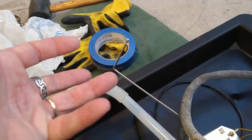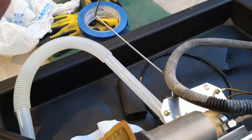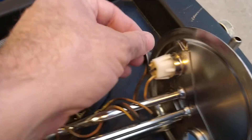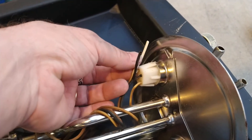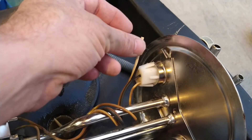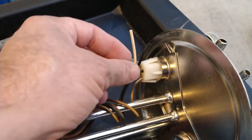That happened within four or five years. Now I'm getting ready to put the new pump in and I'm looking at the old pump to make sure it's the same. I look at the insulation over this wire — it wasn't an inch and a half too long when I put it in there. This insulation actually grew from being soaked in fuel.